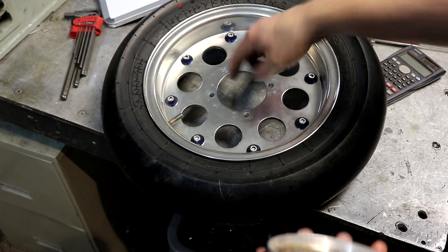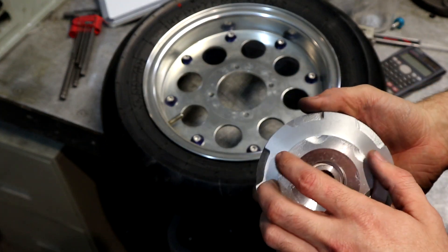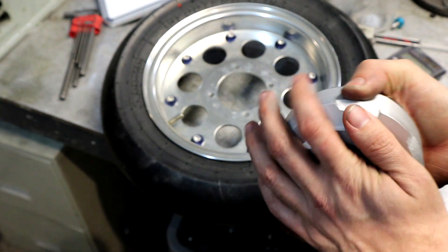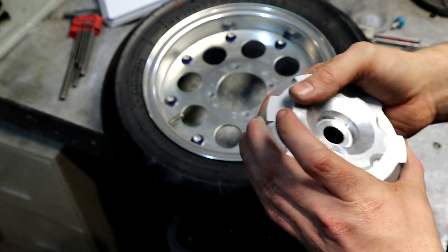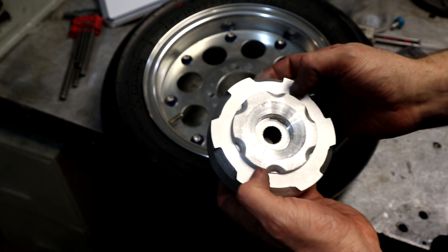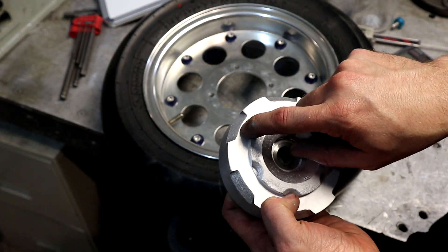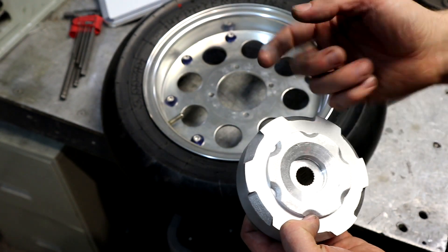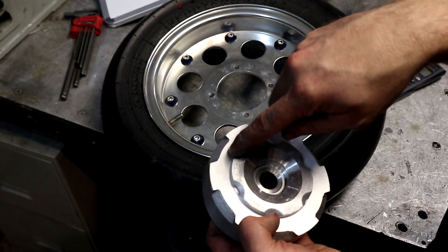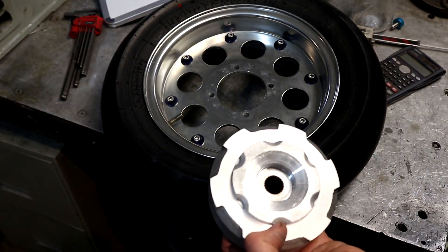There you go — it allows for a monkey bike diameter. I still have to drill and tap for the through bolts, but it has a shoulder to register on so all the load isn't just on the bolts. When you lay this out you're going to have two bolt holes coming out this way. Two of them are going to be really close to the edge of this, maybe even lightly on the edge depending on how irregular the casting is. That won't really matter too much — if you put a light chamfer on that, the first thread's going to go away anyway. It'll be fine.